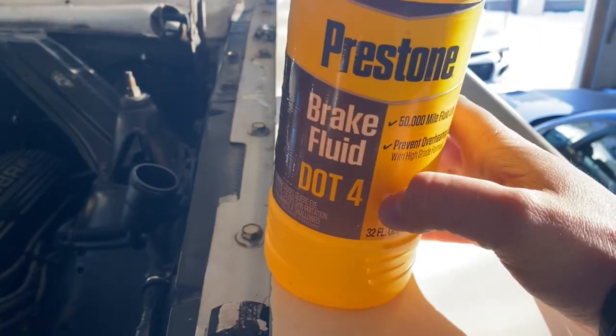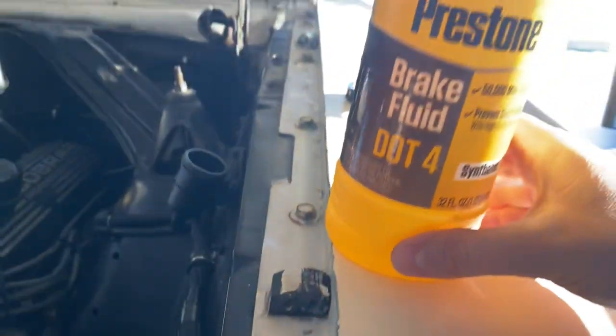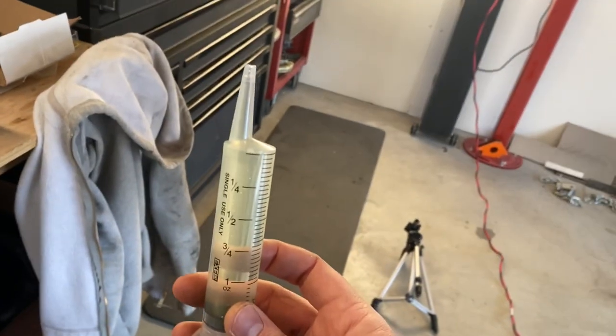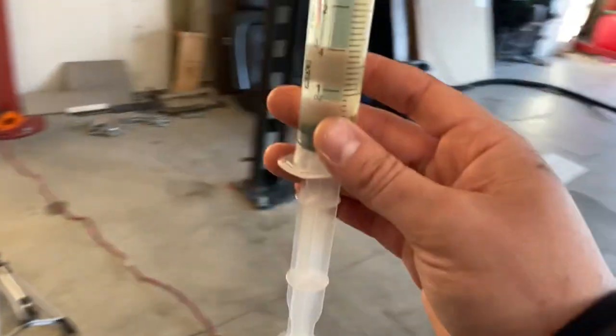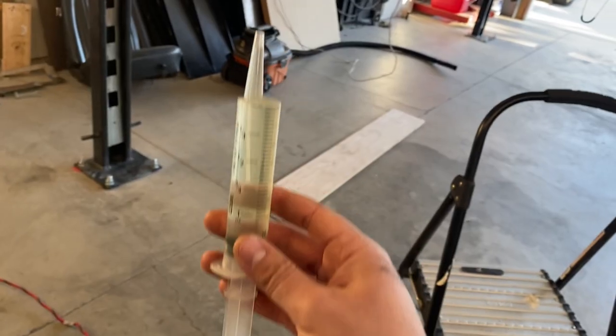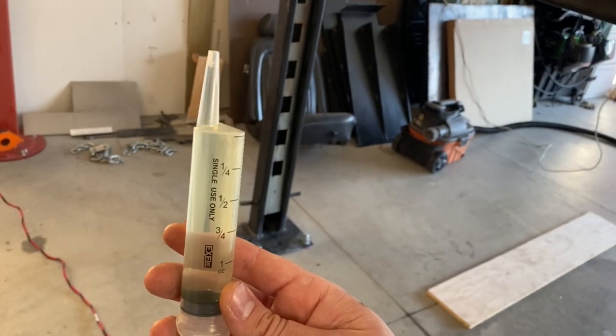The loop makes a little trap so you can't suck air back in — it'll make more sense later. With the bleeder shut, you don't need to use DOT 4, DOT 3 works — it does need to be synthetic. Fill the reservoir and watch it drain down as you fill because it's gravity bleeding. With the bladder installed per the picture into the master cylinder reservoir, draw fluid up into the syringe. Make sure you don't have air trapped at the end — squeeze it out a little — then put it up in there, go under the car, open the bleed screw, press it down in three seconds, close the bleed screw, and hopefully it's bled.